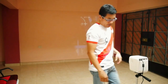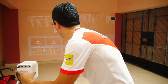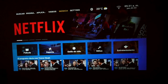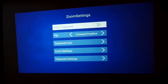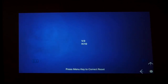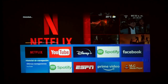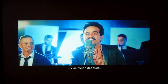An important feature of this projector is its keystone correction system. It is not mandatory that the projector faces the wall — you can place it at any end of your room. But by putting a projector at one end, the image will be very distorted, showing a shorter and a longer end. To correct this distortion, enter the projector option, select the trapezoid 4-point option, and then with the remote control, move the white dots that appear in the corners — doing this in every corner to restore the screen shape. This is very helpful so as not to have the projector always in a single position.